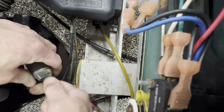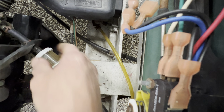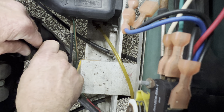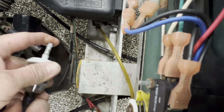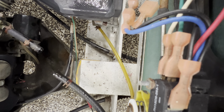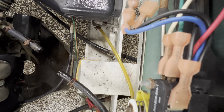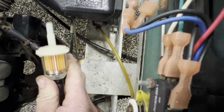Spin this to kind of break it loose — I can break this side loose first. All right, gotta break it loose from the fuel line. Now, I'm gonna be honest with you: whenever you change the fuel filter, be careful sometimes because you can pull too hard and break the plastic fuel pumps. And whoever says they haven't broke a fuel pump hasn't changed enough fuel filters. The fuel filter part goes toward the fuel tank — slider on there.